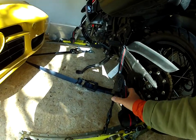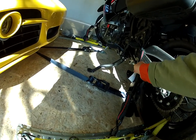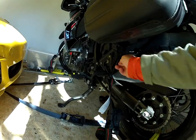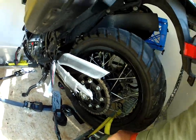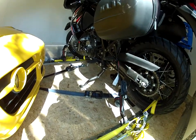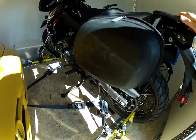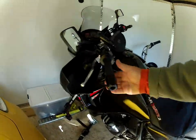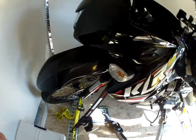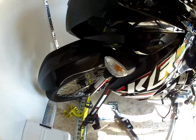I bought these real nice Bike Master two-inch bike straps — these things are heavy duty. I ran a strap from here to here, then wrapped one around the rear tire to keep it from sliding. I put the kickstand down because it felt so solid, and then I locked the steering so it wouldn't turn. Up front, same thing — I secured the front tire with a strap.